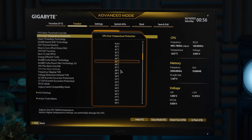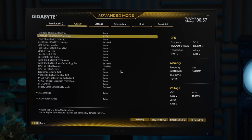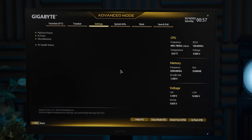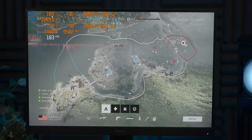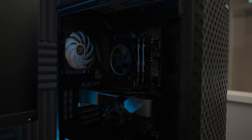I have an idea — let's see what happens when we unshackle the CPU from motherboard-imposed temperature limit protection. It was sitting at 100 degrees before, so let's see how far it lets us go. Unfortunately that's not as high as the 120°C that an NZXT motherboard would let us go, but it is higher. With the additional temperature headroom the CPU keeps trying to stay at 4.9 GHz — but apparently the 12900K does not like running at 110 degrees Celsius.